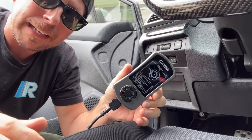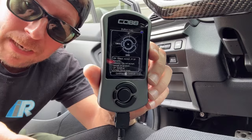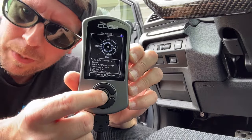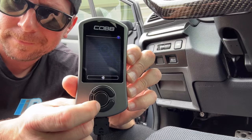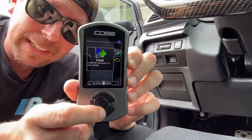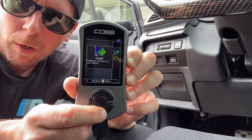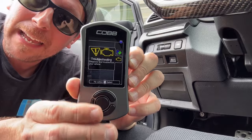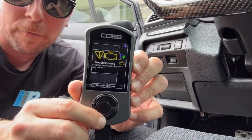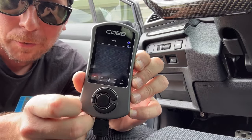If it's your very first time plugging in the Accessport, you're going to see a screen that's simply a breakdown of what all the buttons do. Hit the big center OK button. At this point it brings us to the install screen. If you have a buddy who has an Accessport and you want to check engine lights or any other diagnostics, you can go down and do that even if the Accessport isn't synced to your vehicle. But today we're looking to install a tune, so we're going to go up and hit OK.